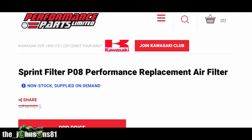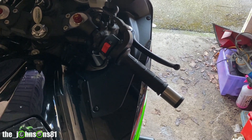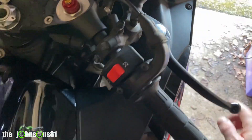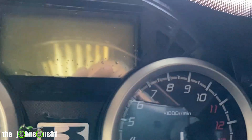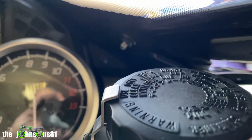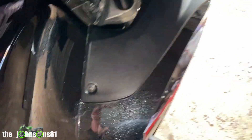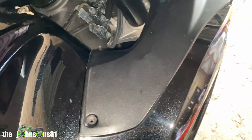No duty to pay, obviously, because it's the UK — so nothing to worry about there. To fit the air filter, the first thing you have to do is remove this top fairing piece on the air ducting. That's a five-minute allen key job — three bolts: one at the bottom, one at the top, and one on the dash up here. Just don't lose the plastic washers.